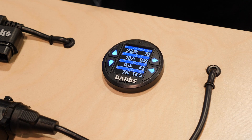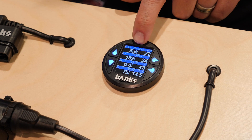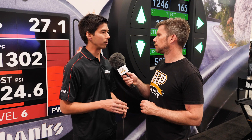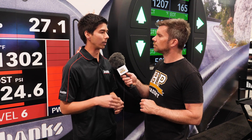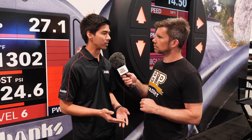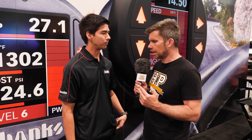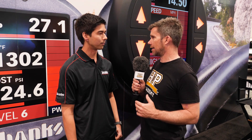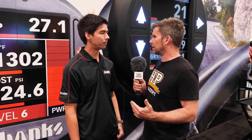When we calibrate the device, we look at exactly when the ECU detects that something's not quite normal. We can then fine-tune the calibration to adjust the amount of fuel and air at those particular spots to ensure the absolute best performance without triggering check engine lights. That OBD2 interface gives a lot more control over exactly when and where fuel is delivered, as well as the safety elements — monitoring aspects such as EGT.